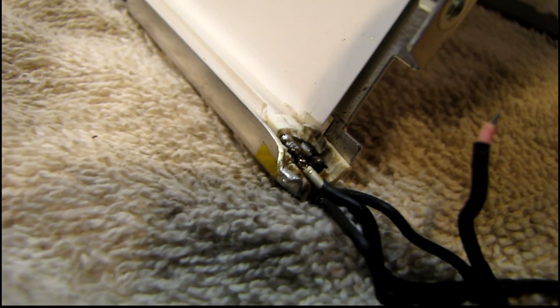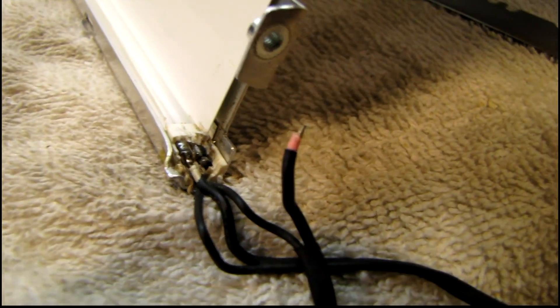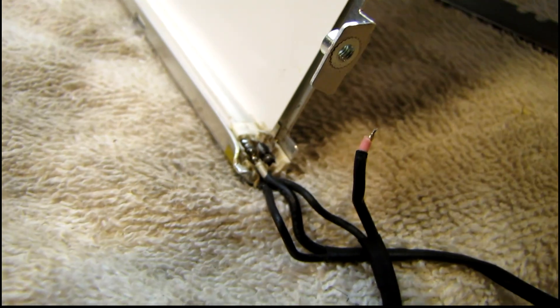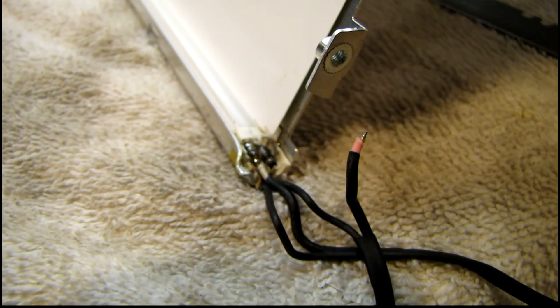The end of that CFL is so oxidized and burned — the wire too. I had to use separate flux and a lot of scraping and tinning and retinning, and it just would not take solder. But I got the white one on there now. I'm getting ready to try to get the pink one back on, and then if I can get silicone back in there without breaking the wires off again, I might be good to go.